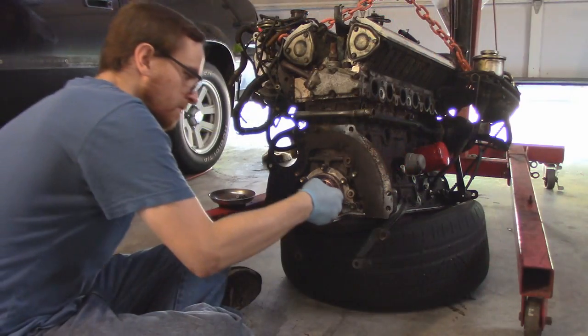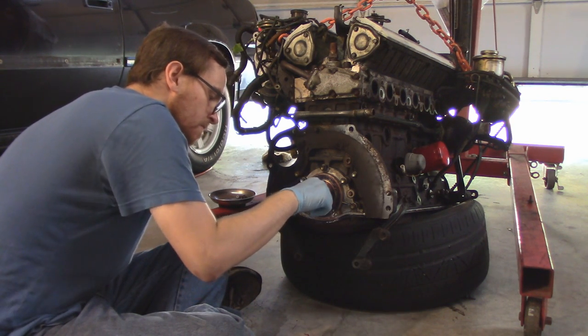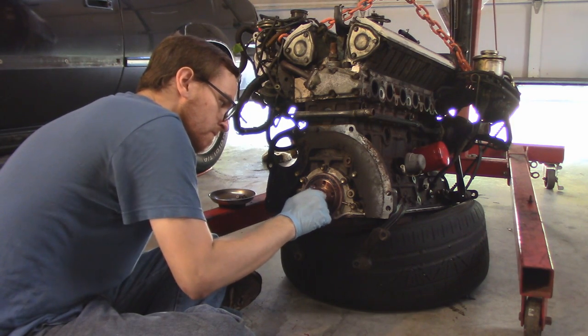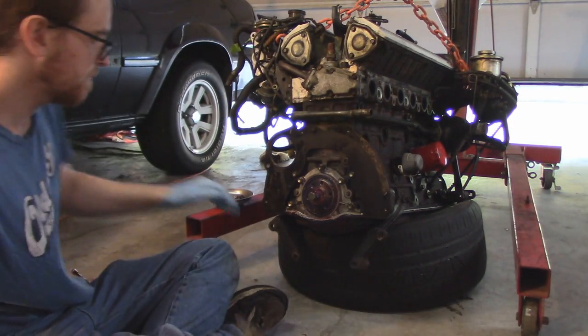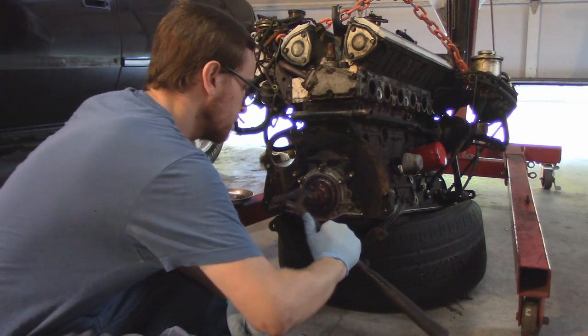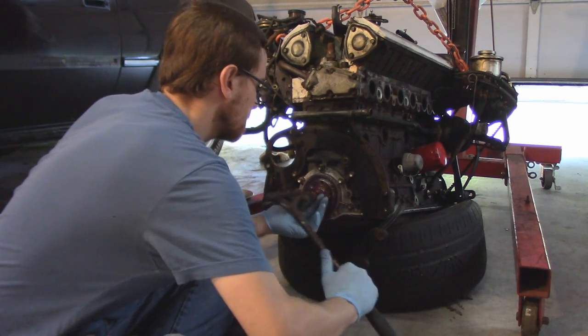So I'm going to be honest with you, it wasn't looking so good in the beginning because the socket didn't seem to be exactly the right size. I didn't have one that was a perfect fit, so grease kept slipping out around the edges of the socket, and it just wasn't making any pressure behind that bearing. Did find a bolt that was a little bit better of a fit and ended up eventually wrapping the threads of it with masking tape, making it a very good seal inside of the bearing.